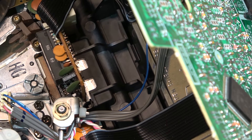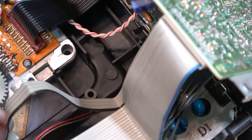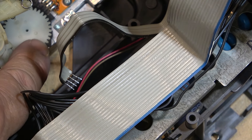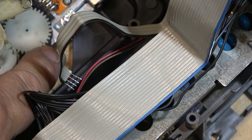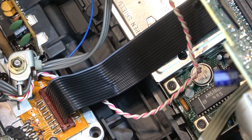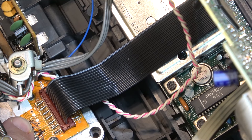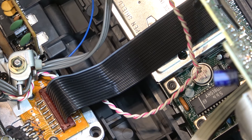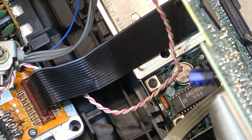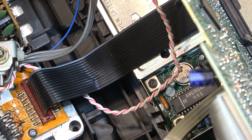In that mode, the mode switch should be pointing at that cutaway. Anyway, I want to get the front loader out of the way. I'm going to get the soldering iron in here with the solder sucker and take off that solder, then I can lift this mode switch out. I can probably do it without taking out the tower gear so I don't have to worry about the mechanism getting untimed.